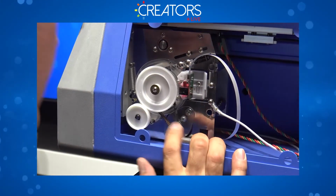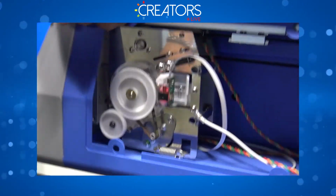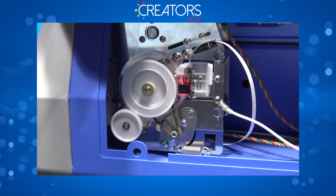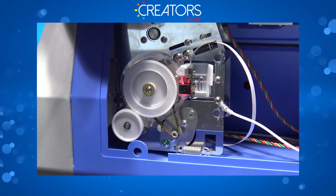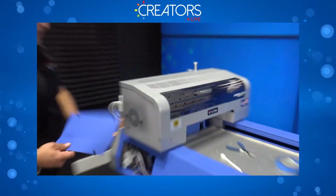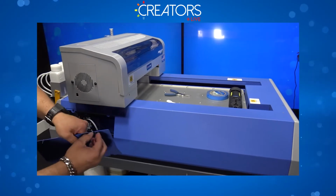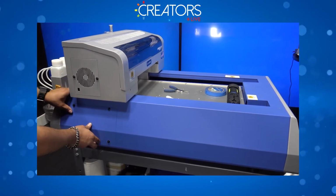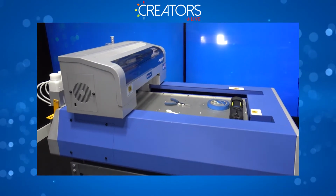And again, this is part of the monthly. The encoder strip is part of the monthly shaft and X-belt. But again, I repeat once again, depending on your environment, if your environment is too dusty, then go ahead and do this on a weekly basis. All right? So you're done with that, and just make sure that you grab your plate or a cover. Make sure that your pins are pulled out. Pretty much done.